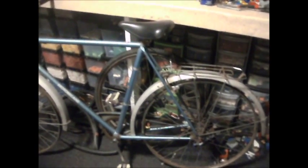I'm doing some extra work on this. The dynamo lights work, I should say. Well, at least off the battery there, I've tested them. I didn't at first. When I first tested it, I just connected one wire to that and then touched one on the bracket. Nothing worked. The front light was easy. That was just a blown light bulb. But the rear one turned out to be that there was no ground connection.